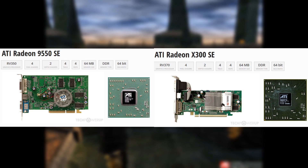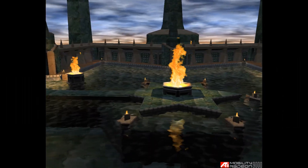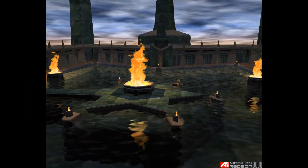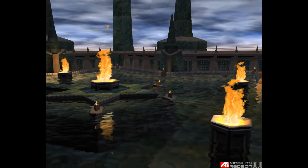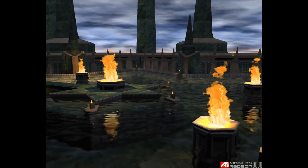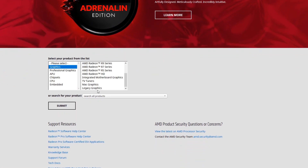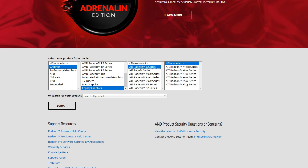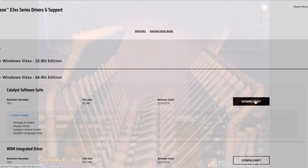We're going to be testing the performance of the X300 at stock today, as MSI Afterburner isn't keen on overclocking these old graphics cards. For overclocking, I'd recommend an OS that isn't Windows 10 for such an old GPU. However, Windows 10 will work perfectly fine with these drivers, but the newest ones are for Windows Vista, which means you need to download the drivers from the AMD website and then select the INF file — not too annoying, takes all of 20 seconds, but you do need to make sure you know what you're doing.